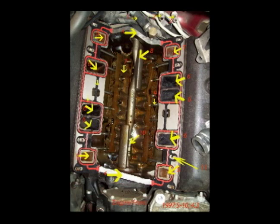Number 7 shows where the engine's valve lifters, which are roller lifters, go. Number 8 shows what they call a counterbalance shaft, which rotates to keep the engine in balance because it's a 6-cylinder. V8s don't need that. And right under the balance shaft, number 10 would be the camshaft that opens the valves. It has the lobes on it, eccentric lobes. Number 9 shows the push rods that go up from the camshaft and valve lifters to open each and every valve. Number 11 shows the holes where the intake manifold bolts go to hold the intake to the engine. There are 8 intake bolts.